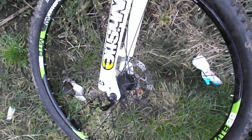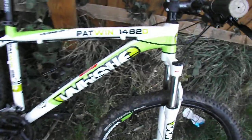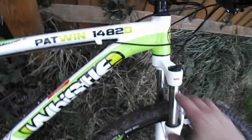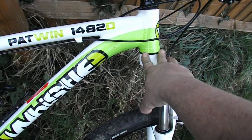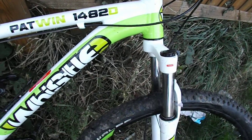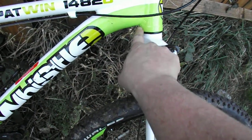This bike new was somewhere around £350, and for that the actual Carrera and B-Twin offerings would have been a bit of a better deal. We also have a straight head tube, which for about the time when this was manufactured is about standard. There are no gussets or anything under here, and there's quite a lot of space here, so that's a bit of a stress raiser.